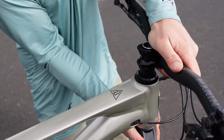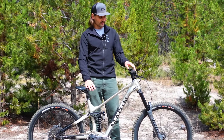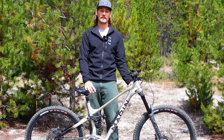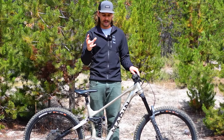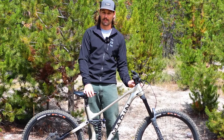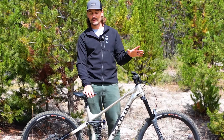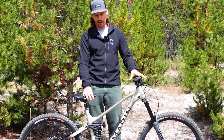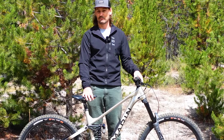My only slight worry with this whole design is the plastic, essentially washer, that sits between the lower cup and the bearing that helps mitigate any of the kind of change or angle that happens when you change out this top cup. I didn't experience any issues with it while riding, but I could see that being a fail point, especially if you're improperly torquing your headset compression cap.